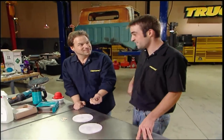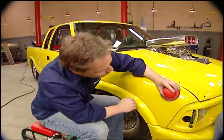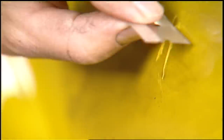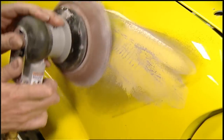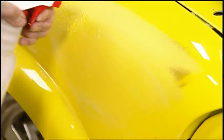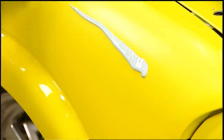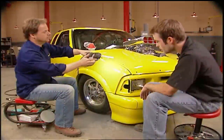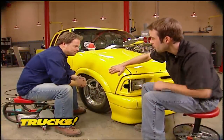You can feel the run but can't see it very well, so use graphite powder — normally used for guide coating primer surfacer and blocking — to show it up. With the ends of the blade turned up, scrape along the top of the run with light pressure until you level it with the rest of the clear coat. Then with dry 1500-grit on a DA, blend the scraped area into the rest of the panel by sanding. Switch to 3000-grit lubricated with water and go over the repair two or three times. Finish the repair with a buffer and 3M Trizac rubbing compound, buffing it back to full gloss — the run is gone, and the surface is nice and smooth.